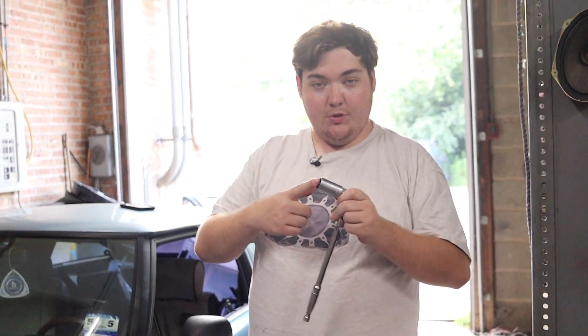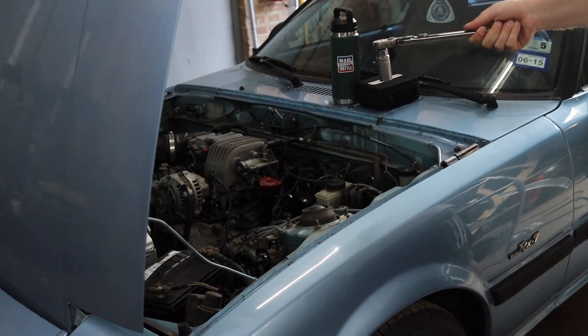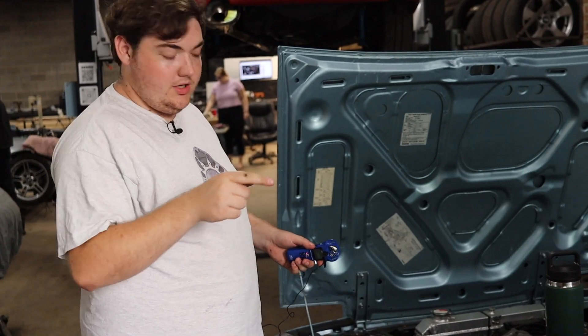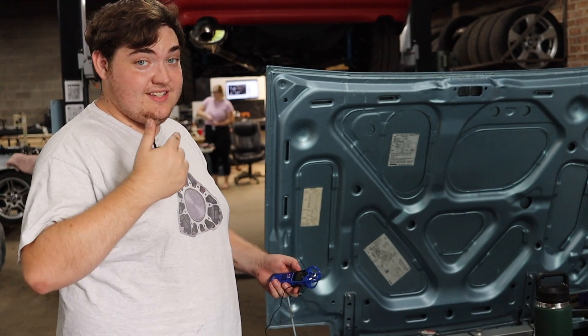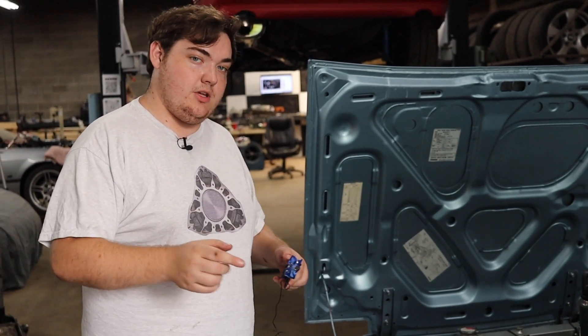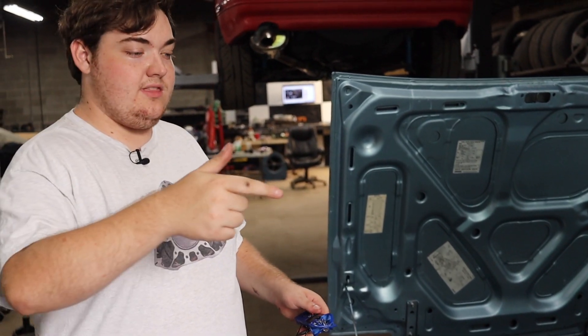Although it's not super exact, you're going to need a spark plug socket, a wrench, and a 19 millimeter socket. The first thing you want to do is take the spark plugs out of one housing. We unplugged the crank angle sensor, and then we're going to crank the car over. You can also do this with a 19 millimeter wrench at the very front of the engine and spin it over by hand, but it's easier to hear with the car actually trying to start.